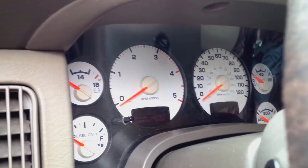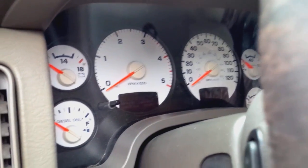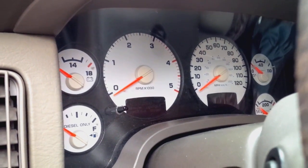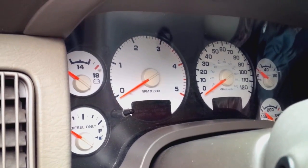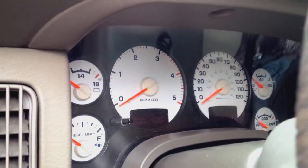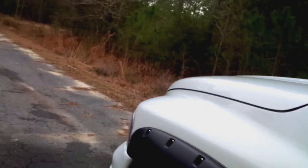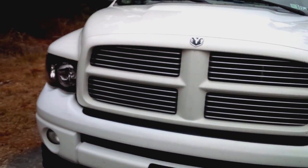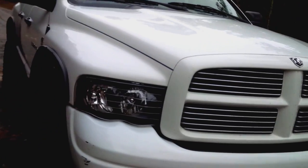Here's your gauge cluster. On 2006 models in particular, you could have electronic issues with this that require just some of the connections fixed. This isn't really a problem on any other model year for some reason. So overall problem issues, all third gens have the weakness of injectors. The extra injection event on the 04.5 plus kind of magnifies that issue a bit, according to certain people.